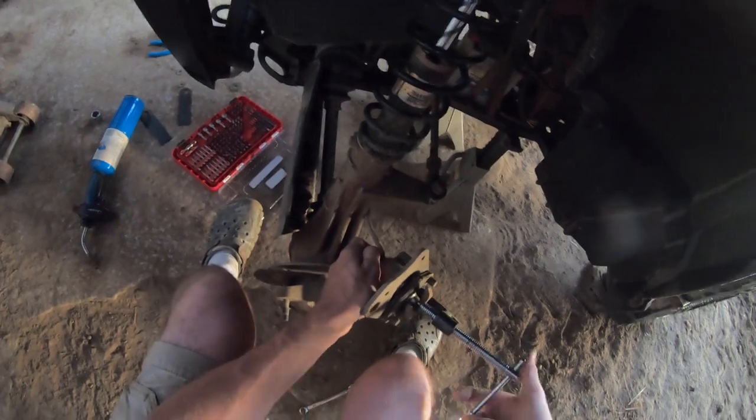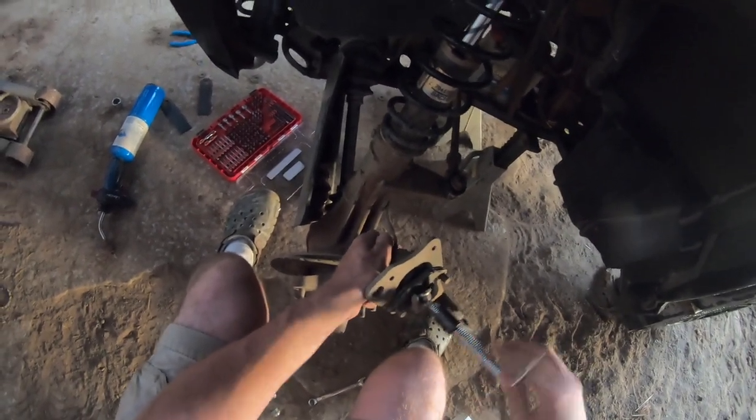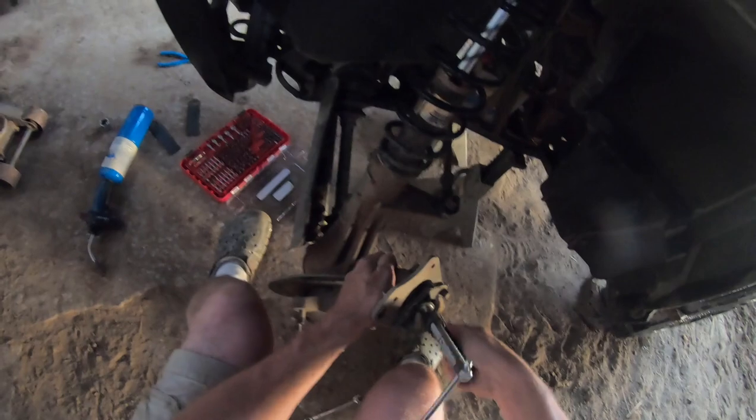Like on the F-150, my black F-150 — you can take a big screwdriver, get under the caliper, and decompress the cylinder that way. They also make a whole kit that decompresses the cylinder, if that's what you're looking for. No big deal.